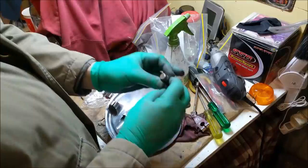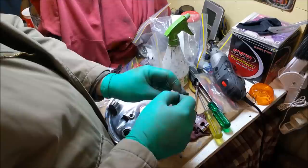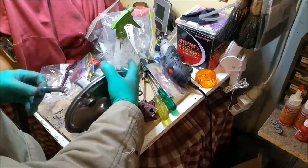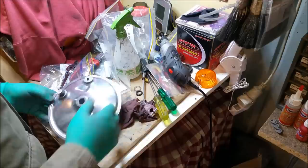Right, and we can see it's got a master spline and a dot. Anytime grease is used on anything like this, it's got to be high temperature bearing grease, just so it doesn't liquefy all over your brakes. That would be kind of bad. The item sits like that in the bike, so this would go in like so, and we've got the felt.